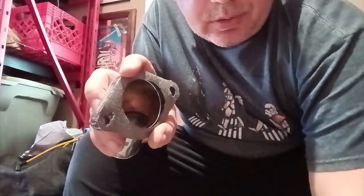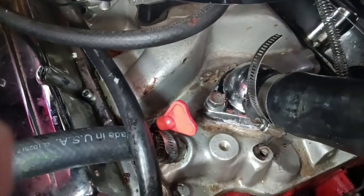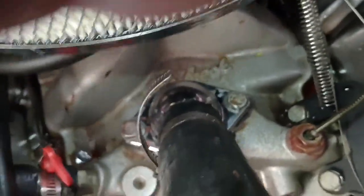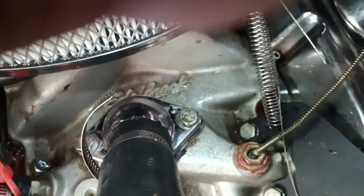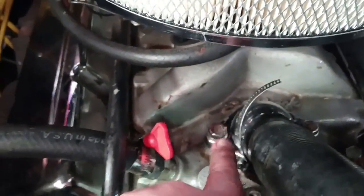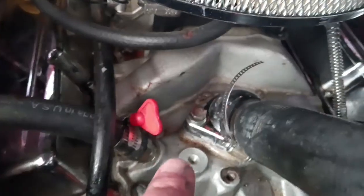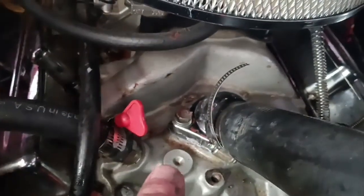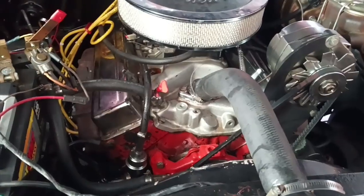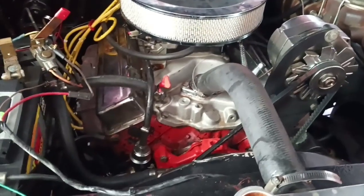So now we're going to go ahead and put the silicone on and the thermostat housing back on. I have the thermostat on with the correct silicone on it. I even did my best to sop up all the coolant that was sitting on top of this intake so that when I fill it back up and start it, I can see if I have any new leaks. I did notice that this bolt right here bottomed out and still had some height to it — it was longer than the other bolt. So I took some washers just so it would push down; that also could have been causing the leak. I'm going to let that silicone sit for a couple hours and make sure it sets, then I'll put the coolant in and start it up.